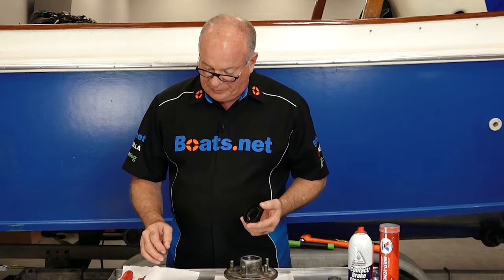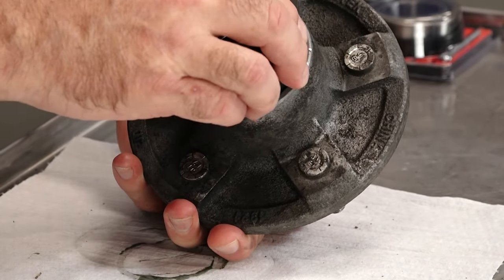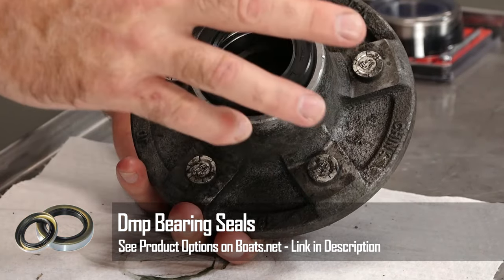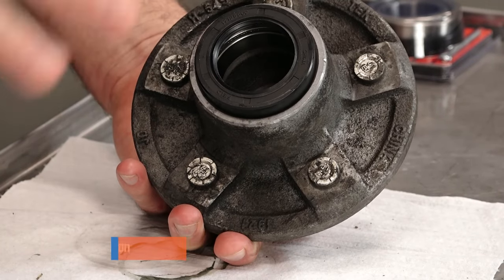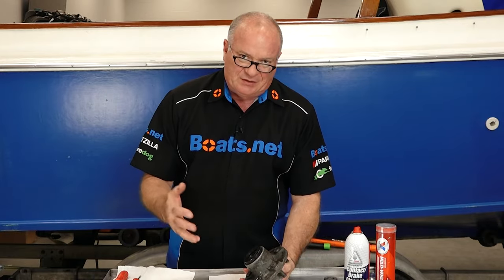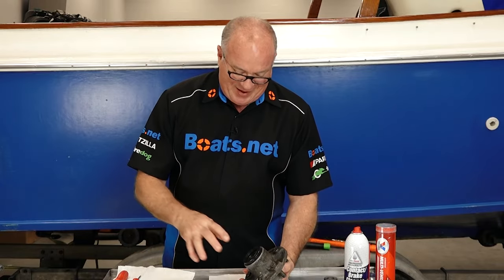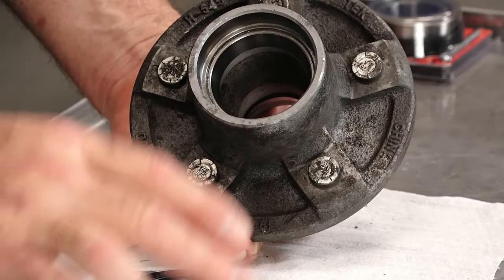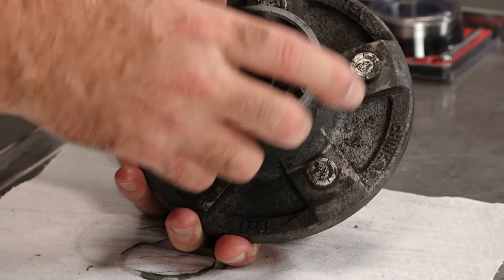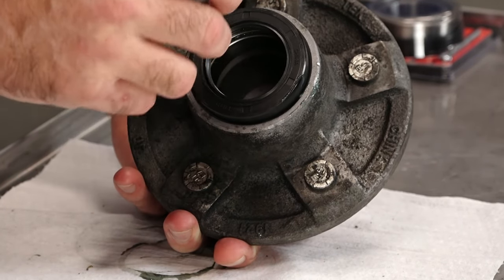I am upgrading the seal a little bit. This is what they call a three-step type seal — it's got three lips on the inside, and on the outside it seals the outside as well. I know that's a little extreme, but if you're constantly having to back your trailer down into the water and leaving it for any length of time, water can find its way in there and start to corrode around that metal area going into the hub itself. A rubber-on-metal-on-metal design isolates it and keeps that from happening.